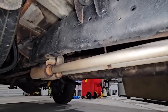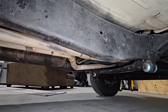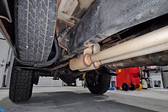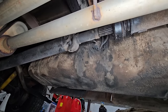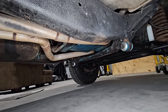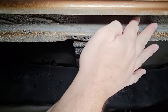Overall, everything down here is in really good shape. My father said the mufflers for the exhaust had been changed out, and it looks to be a full cat-back system. He's going to put a quieter exhaust on this truck. I don't see any signs of significant rust down here. Let's take a look at the carrier bearing — looks like that may have been replaced at some point. Really nice. The truck just seems to be in really good shape.